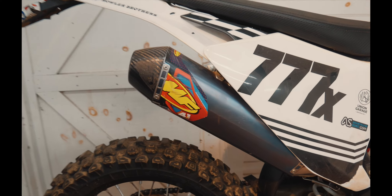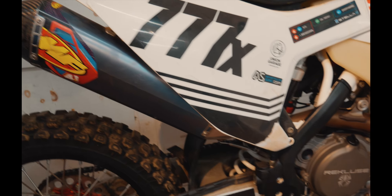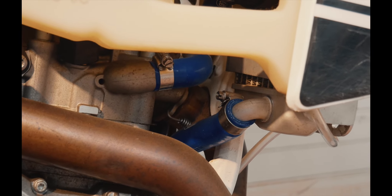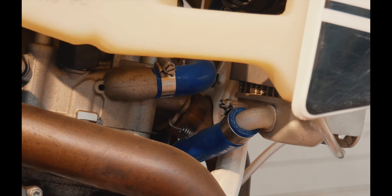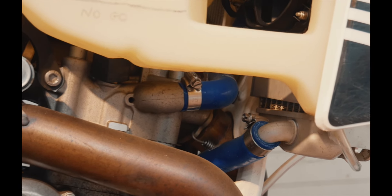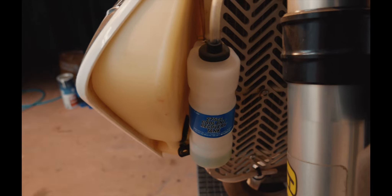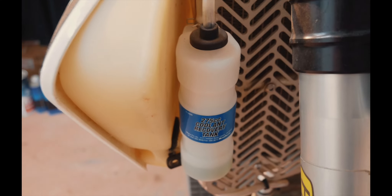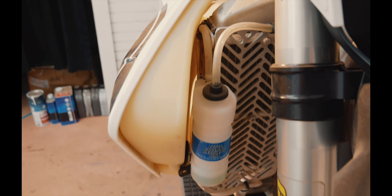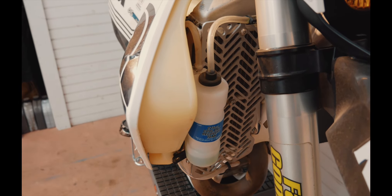You can see I've got an FMF titanium and carbon fiber slip-on exhaust, paired with just the stock header. You can see some more blue hoses out there. I not only put on those hoses but simplified the hose routing — got rid of a hard Y that goes in there — and this just improves coolant flow. And over here tucked in the fairing, there's a coolant catch can or overflow canister. One thing we ran into was overheating, so if we run into that again, at least we can reclaim some of that coolant — when it comes down to temperature, it can cycle itself back into the system.